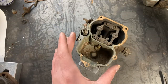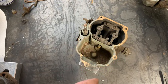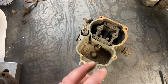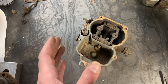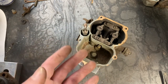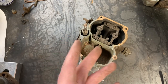You start running into issues with modified engines. When you go into multi-carb scenarios, the odds of you running a different exhaust, a different stroke, a different bore — it's all common. One very common thing is to put a high lift cam in the engine. When you put a high lift cam in the engine, it affects your vacuum reading. You affect your vacuum reading, you're going to get all sorts of different signals sent to this power valve and you're going to run into all sorts of issues.